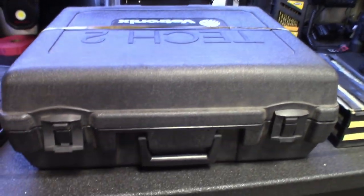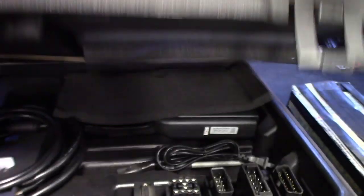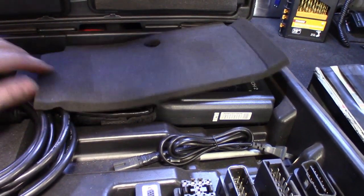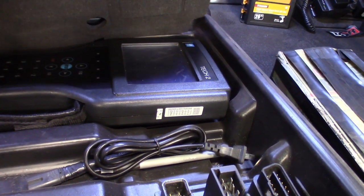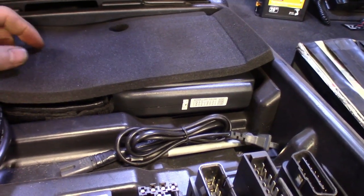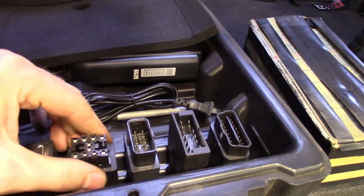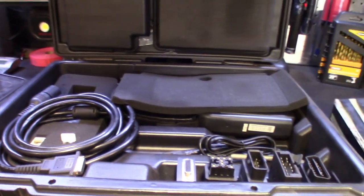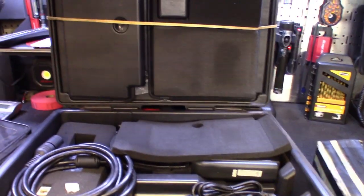Then I started looking at the blow molded cases. This big one here — I've got the Tech 2 in there, thinking about taking it home, but I still do use this one. Just the other day I had a G6 in here and had to unlock the radio. It's outdated by now — I'm actually looking into getting the wireless MDI and hooking it up to my laptop — but it still does the job quickest. The Verus doesn't unlock GM radios or control some of the modules the way the Tech 2 does. It's got all the connectors, OBD1 and OBD2, and I've got the CANDI module in it, so I can't bring myself to bring this thing home.